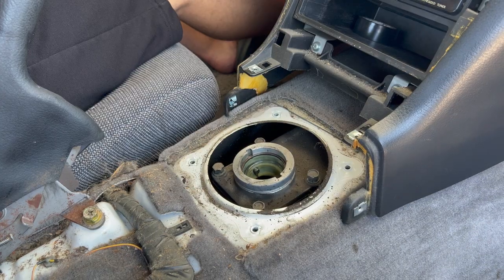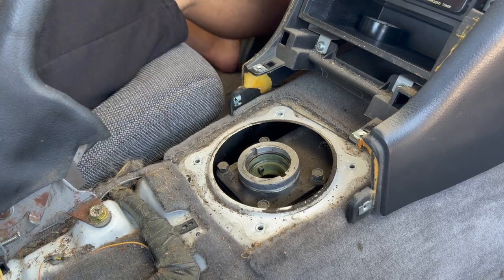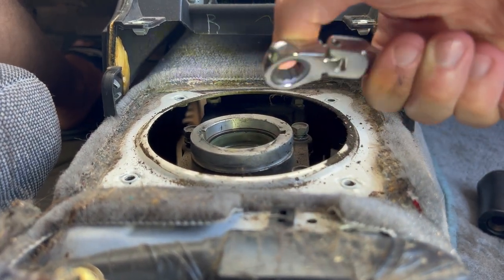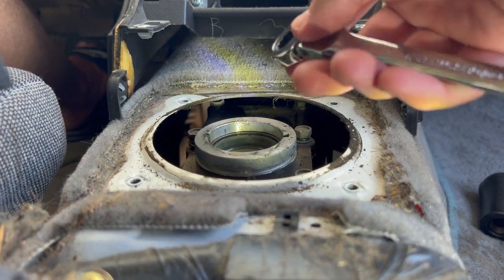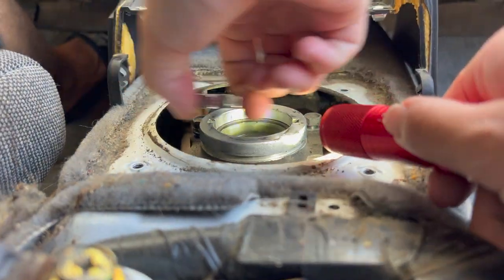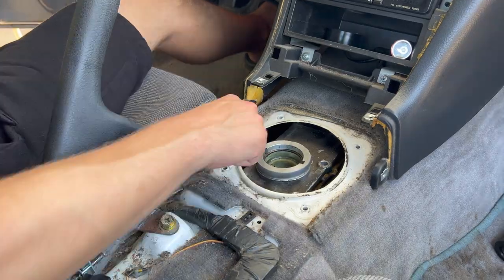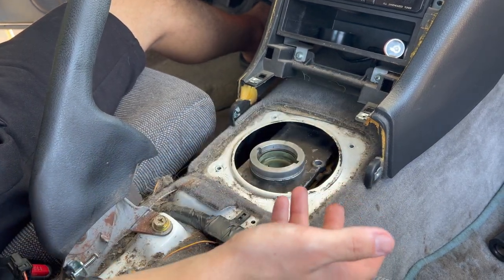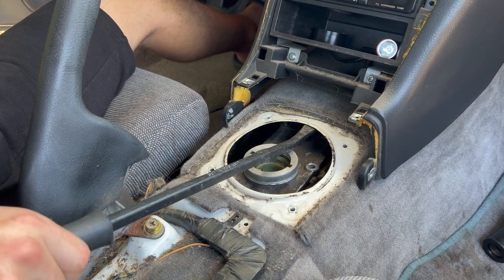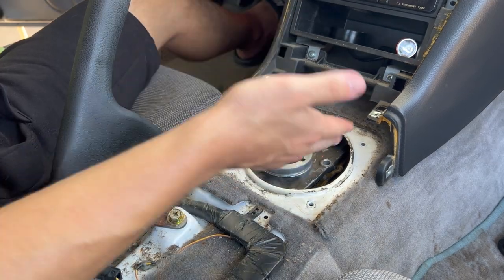With just that it pulls right out. It's honestly not that bad — it's just really old. Now with the 12mm we're going to take the top side of the transmission mount off; there are two bolts hidden all the way up there — stupid design but we got the tool for it. All the way down in the corner there are two more bolts we're going to get with a ratcheting wrench. This has a flex head — it's an off-brand GearWrench, I'll leave a link below. If your trans tunnel isn't chopped up because of a previous short shifter install, grab a pry bar and lift that section of metal up so you can get the screws out.